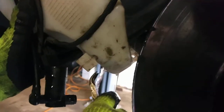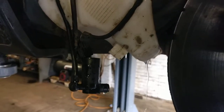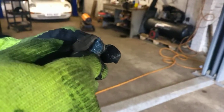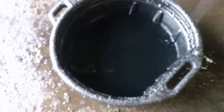This is a screen wash pump and setup from a Ford Focus. The reason the new pump didn't work is because it was stuffed with jelly. If you put in a lot of screen wash, it settles all the way to the bottom and completely blocks that hole. It's a bit mixed with oil now so you can't see it properly, but trust me on that — that was the whole reason.